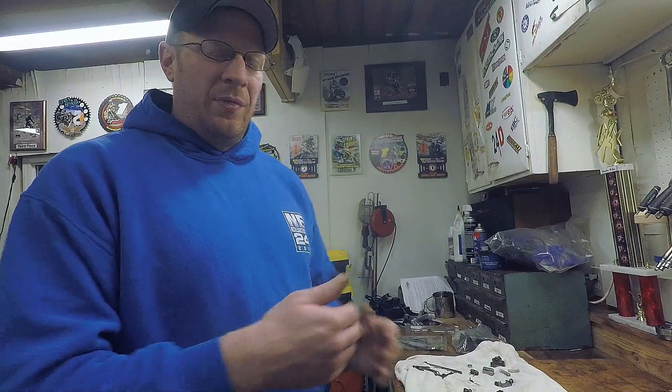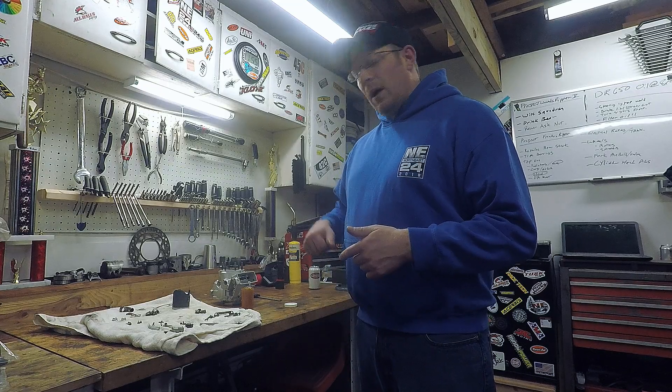I write that stuff down so whenever I pull this back apart I can measure everything and see how much wear accumulated over a certain amount of time. When I go back to a Pro X piston I can measure it up, figure out what I'm doing wrong — maybe oil choice, filter maintenance, or conditions. You can track engine wear through all these measurements. It took me about 45 minutes to go through everything — always good peace of mind to know it's going to work.